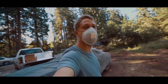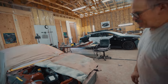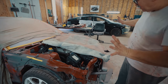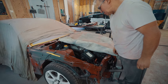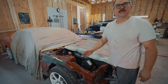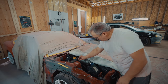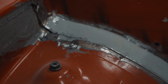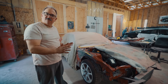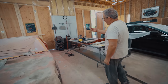Things are getting serious — we're wearing masks! Hey mate, hi Dan. So give me an update on the car. The first things we did after removing all the parts was look at the rust. We noticed there was a little bit more rust and actually some perforation, so we cut out the entire lip and rebuilt a new lip. Same thing inside the wheel well — we've rebuilt everything. The seams are going to be the same, everything exactly the same as OEM.